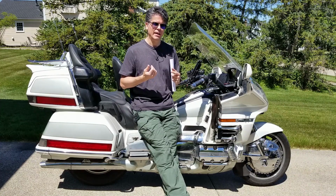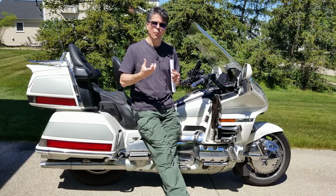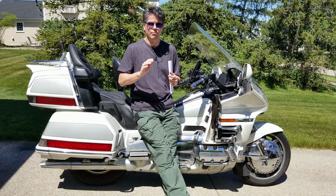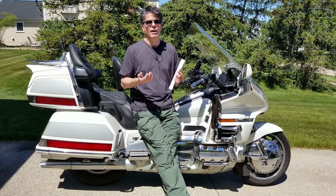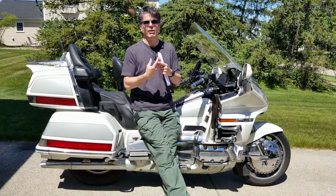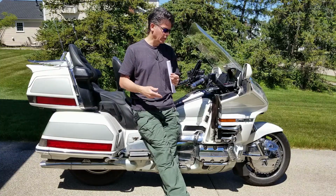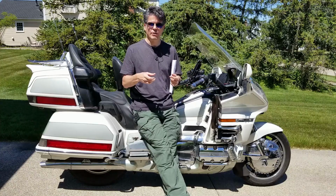You can have a couple things going on here. You might have a gas valve inside your cap that is open too much, or it's stuck open, so it's allowing a lot of movement in and out of air and gas fumes. You might also be filling the gas tank too much, so that instead of pushing air out, it's actually pushing gasoline out. So make sure you aren't filling your tank all the way right to the very, very top. Leave some airspace in there.